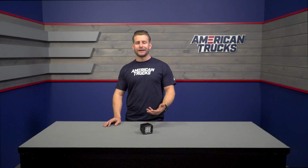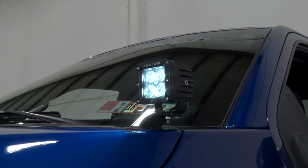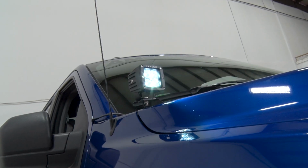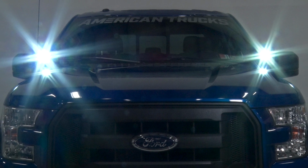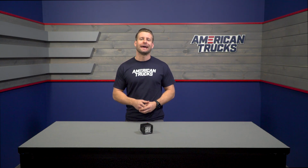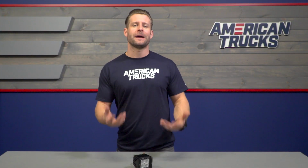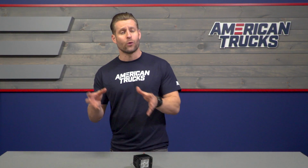But going even further into the Raxiom, you're going to find 4 individual 3-watt Cree LEDs putting out a rather impressive 1200 plus lumens at that 6000K color temperature, which is essentially that bright white light with a small touch of blue. Now this is a pretty common color temperature in the LED world and therefore should match other aftermarket LED lighting or even some factory HID or LED headlights if your truck is equipped.